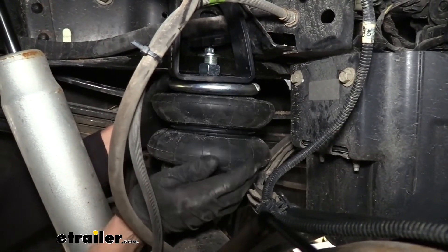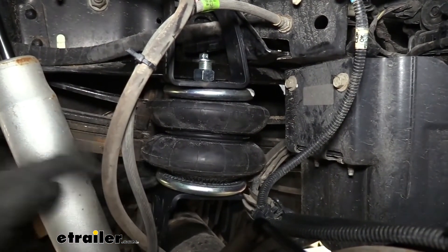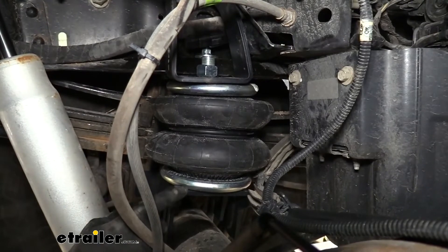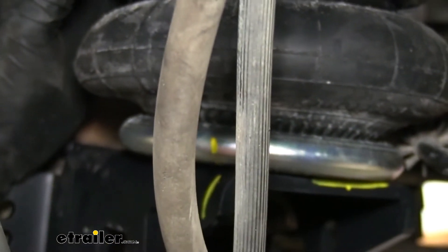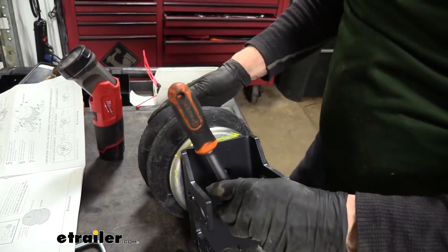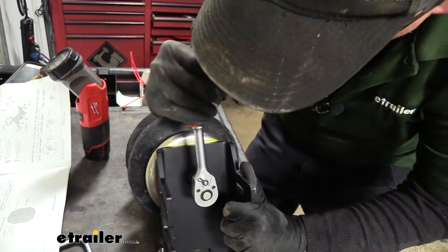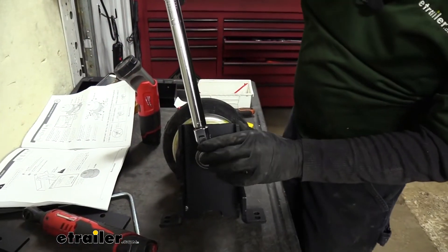The bag will sit like this because the bottom of the frame and the axle will torque the bottom a little toward the front, which is fine — we just want a straight line from front to rear. Once in position, mark it and take it off to tighten the hardware on the very bottom. Line up the marks, get it hand tight, double-check alignment, then use a torque wrench to torque it to proper spec as listed in the instructions.